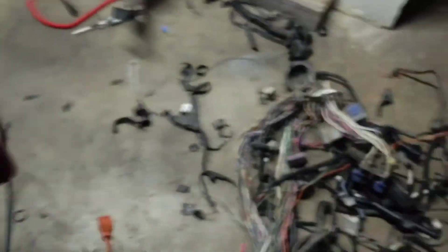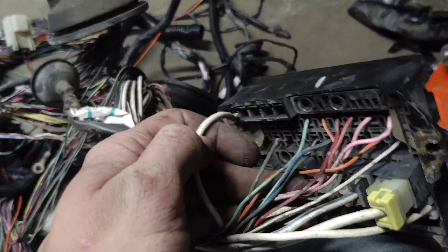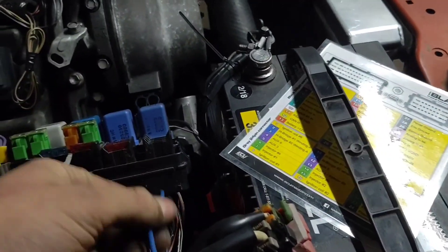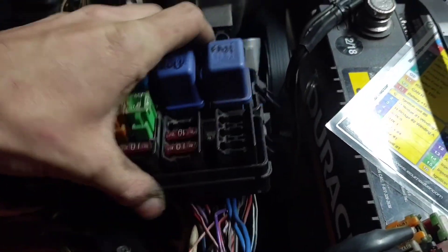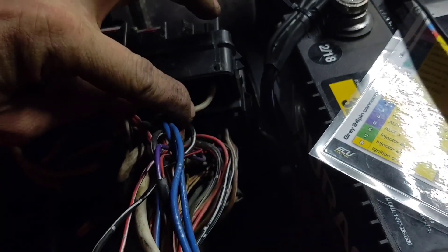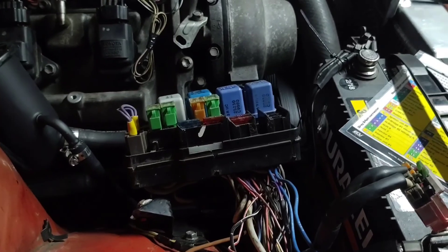All the wires that were in here were small, but I had an entire Nissan hard body harness and its wires were this big. All I had to do was pop out these wires, pop the factory ones out of the 240, and just plug and play — nice and simple. So now I can run a much larger fuse without possibly frying anything because it's supplied with big wires. I'm hoping that it will eliminate some cross talk or voltage drop.